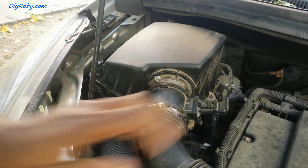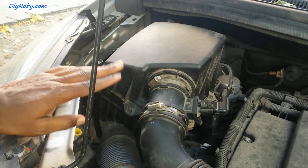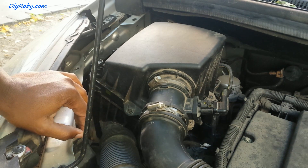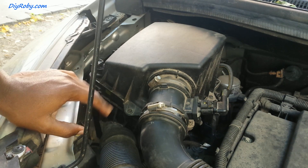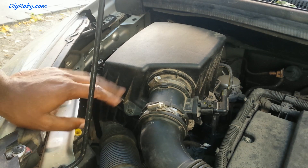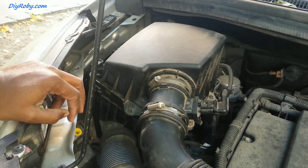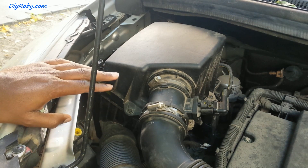This is how the MAF sensor is cleaned and maintained. I didn't show the exact method of spraying on the sensor itself because I didn't have the spray — I went ahead and used a little bit of 99% alcohol. Don't follow that method; I'm just a DIYer and I don't want to invest so much money before I know this is actually the problem. Follow the video in the description below to find out exactly how to spray clean that sensor.